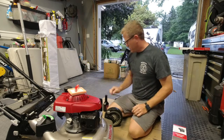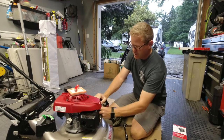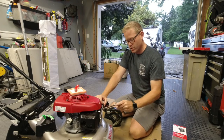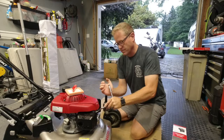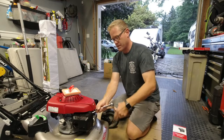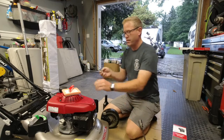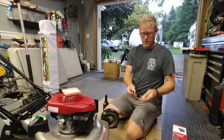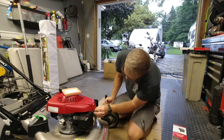I'm going to show you that. The spark plug comes pre-gapped on this Honda mower. Up front, you basically pull the boot off — there's a boot here, you just pull on it. Then you put in a spark plug wrench, which has a rubber gasket in it that grabs the spark plug. Once it's on, you get it loosened up. The old one is actually in pretty good shape, but you can see how nice and new the replacement is. Since it comes pre-gapped, all you have to do is take it and get it back into the spark plug hole.